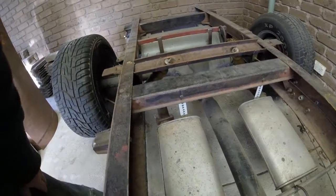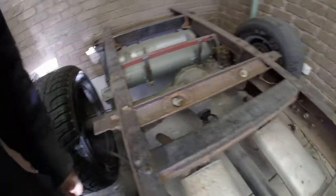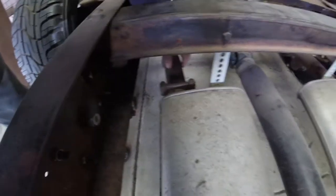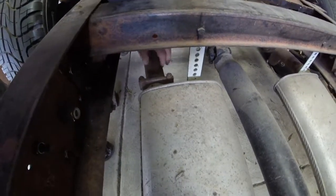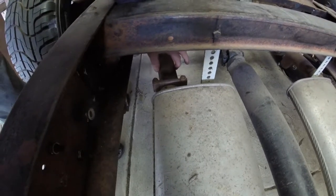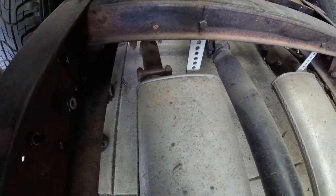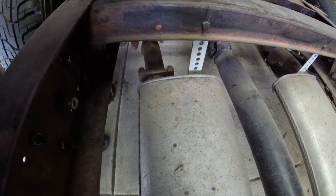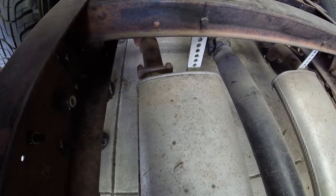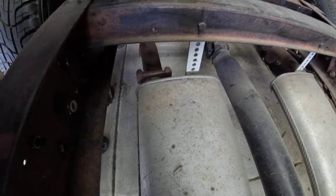And one thing I'm going to do this week is go to a local exhaust place, and ask them, not necessarily this piece of pipe, but if they can give me a 2-inch piece of pipe that flares out to 2.25 inch, because I've got these big massive 3-inch chrome tips that look absolutely beautiful that I want to put on this. But they're 2.25. I couldn't get them in 2-inch. I had to go 2.25.